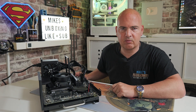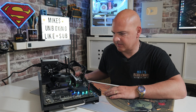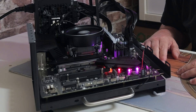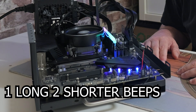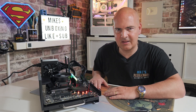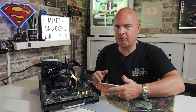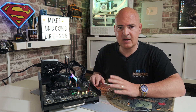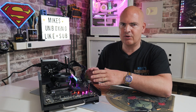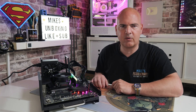So we've got our single stick of RAM installed — which is not always the best idea anyway — and we've got it installed in the wrong slot. Let's see what happens now. So pretty much exactly the same thing. We know the RAM's installed and we know it's installed correctly because the LEDs are lit up and seem to be going through the right process. But the BIOS bleep speaker has come to the rescue and given us our three bleeps to say that although the memory appears to be installed, it's not right. So let's move it into the right slot and see what happens next.